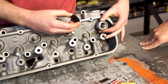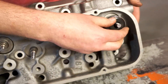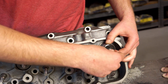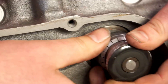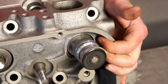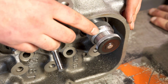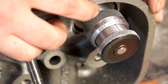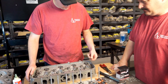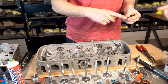What you do is slide it over and put the new retainer on it. Got our brand new locks. When you're checking the install height, some of them will be perfect, but as long as you're within five thousandths, it'll be perfectly fine. So I got this one — it's reading one point nine ten. With that one, I'm going to take a fifteen thousandth shim and put it underneath the rotator, and it'll bring us down to one point eight nine five. You always want the thinner shim to be at the bottom because all the pressure is going to be on that top shim, and it will cause the thinner shim to warp.